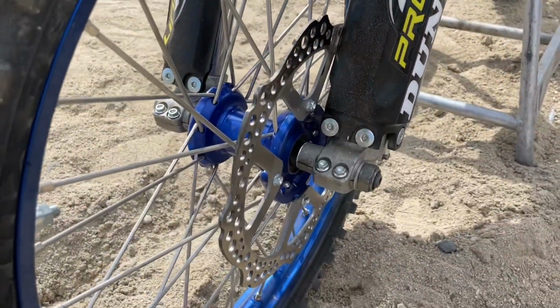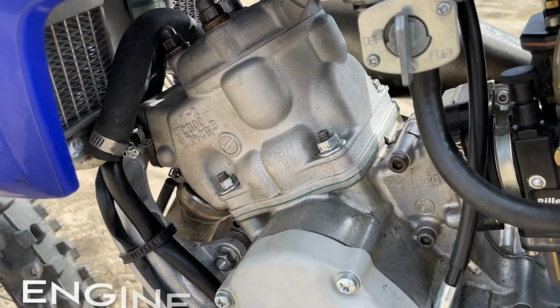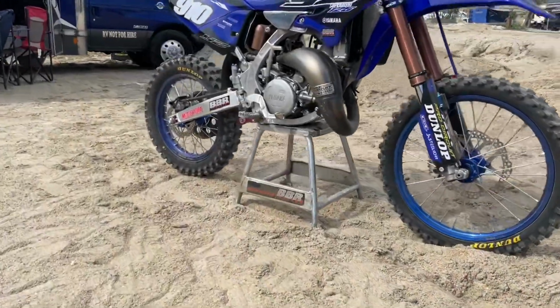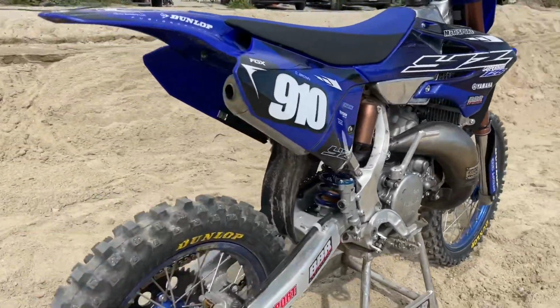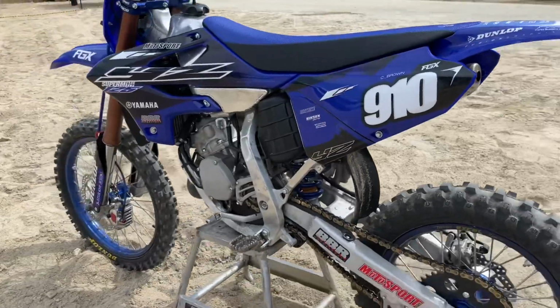Yes, I can see down here. You need good brakes for sure. Yeah, big bike stuff. It runs a full size YZ 125 pipe, air boot, carb, everything. So it's easy to work on and replace. It's basically the same speed. We punched this one out to a 132. When it was a 125, it was actually a little bit tough to ride because the power comes on so abrupt in the little bike. So we punched it to a 132 and it actually smoothed it out a bit. So that helps a bunch. It just makes power right in one torquey spot.